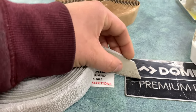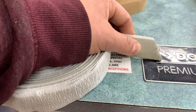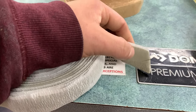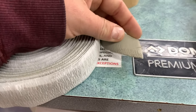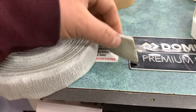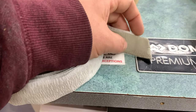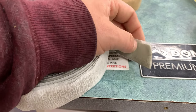It comes on a tape roll and this product will get put on the back of a window frame or around the bottom flange of a vent or a skylight, and then when you screw through the window or the skylight or whatever it is you're sealing, this putty will actually squish out. It's almost like using plumber's putty in a drain — it's really sticky and when it squishes out you can trim that off after.